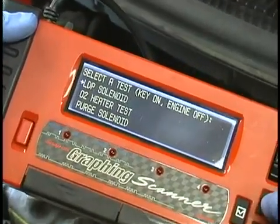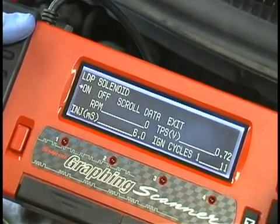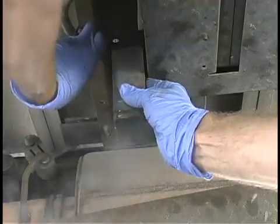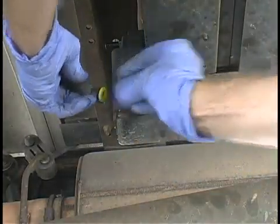If the vehicle is equipped with a vent solenoid that's normally open, it is necessary to close this solenoid using your scan tool before pressurizing the evap system. Sometimes it is also possible to pinch or plug the lines near the vents to seal the system.